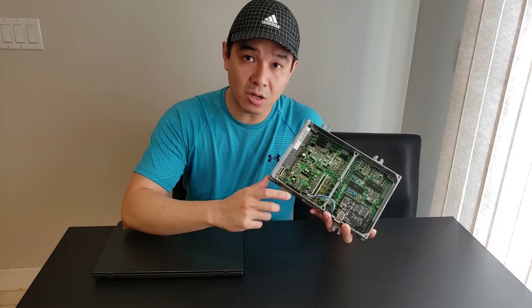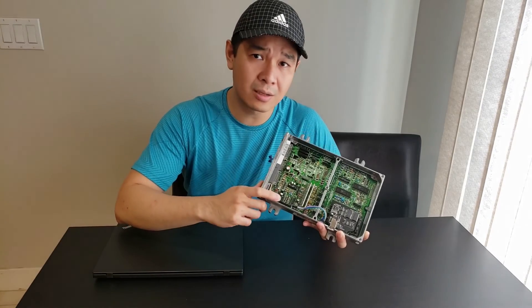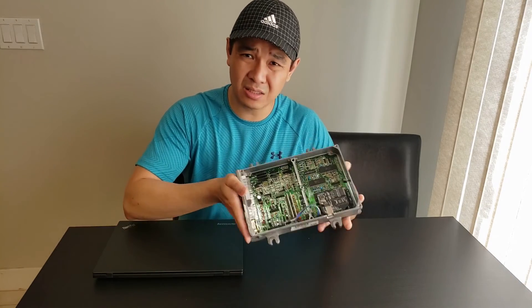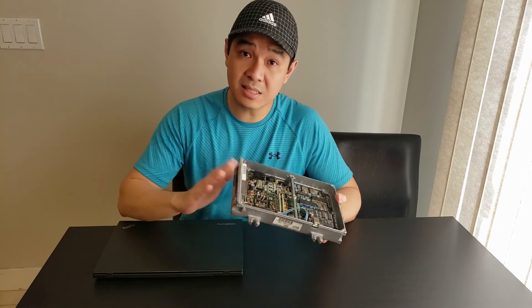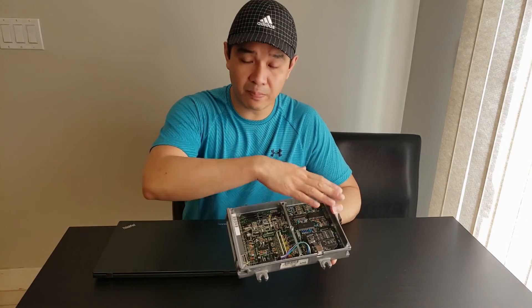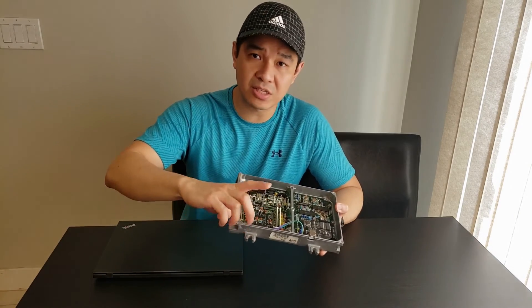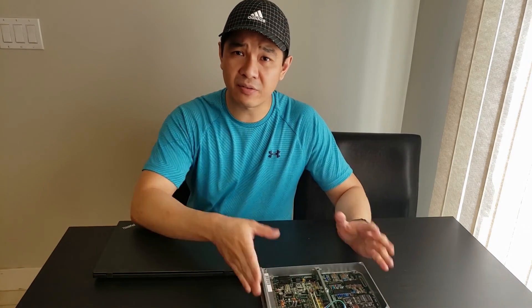I've gone ahead and installed the other Bluetooth module into my P06 ECU, reset it, and called it 'Honda P06 data logger.' So now both ECUs have Bluetooth data logging capabilities. This is the ECU with the VTEC emulator — that's why I have it double-sided taped on this side. You can put it anywhere you want, extend the wires and put it up top, but I found the most convenient way is just to put it on the side of the ECU. That's basically it for this video — if you haven't already, please comment, like, subscribe, and share. See you in the next one, cheers.